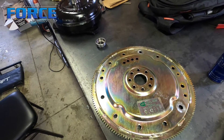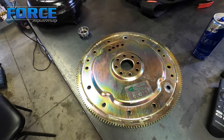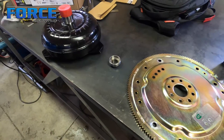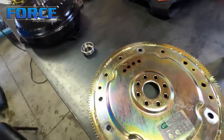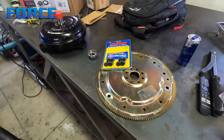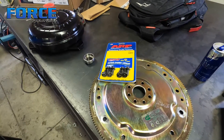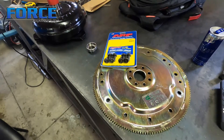Make sure you check that kind of thing before you get too far — I would have been really upset if I hadn't noticed that until the flex plate was torqued in the car. That's done now. I've got my package of flex plate bolts, so I'm going to climb back under and torque the flex plate in, then slip the converter and trans in and bolt everything up.